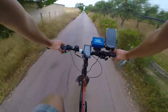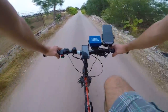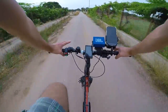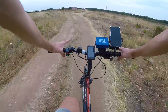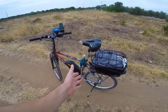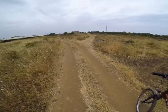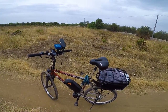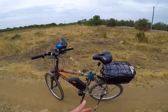I've got some last stuff to share. To give them more emphasis, I'm in my hometown now on my second 500W mid-drive build. The last question I want to leave you with is: do you really need all this power? Let's not consider legal concerns this time. The 750W Bafang kit offers a max torque of 160 Nm, which may come really handy if you live in a place with plenty of steep climbs. This bike has V-brakes and an ugly basket, but it's enough for what I need. In case you live in a flat area with sporadic climbs, going for such a powerful motor may affect your range if not paired with enough battery. That's why I'm absolutely not planning to upgrade this build, which provides 100 Nm of max torque — that's more than enough. What I'm thinking instead is to increase its range with a second spare battery, but this is the topic for another day.